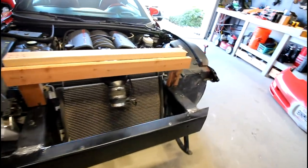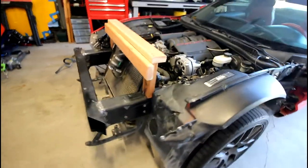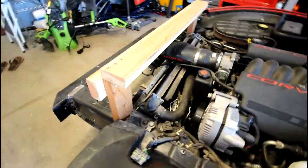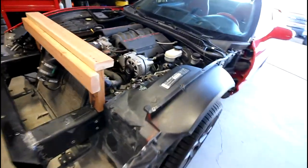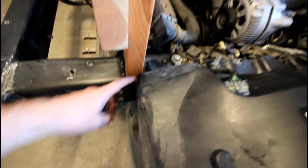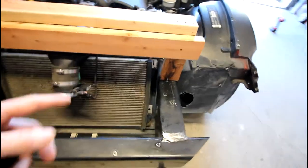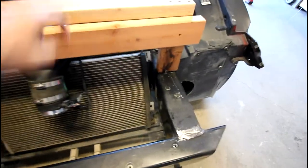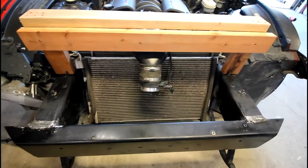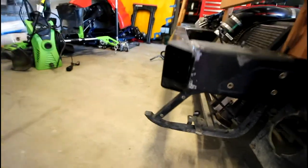I got this little wooden structure here put together to help support the radiator and AC condenser when I take off the lower bracket. I just quickly threw it together — it sits behind the first bolt for the hood bracket and presses up against the inner fender, so it's a nice solid fit. The next step is to take two ratchet straps on either side, loop them under the radiator and over the top of this structure, get it nice and taut, and then that should allow me to take the radiator support bracket out and start prepping the areas to weld underneath.